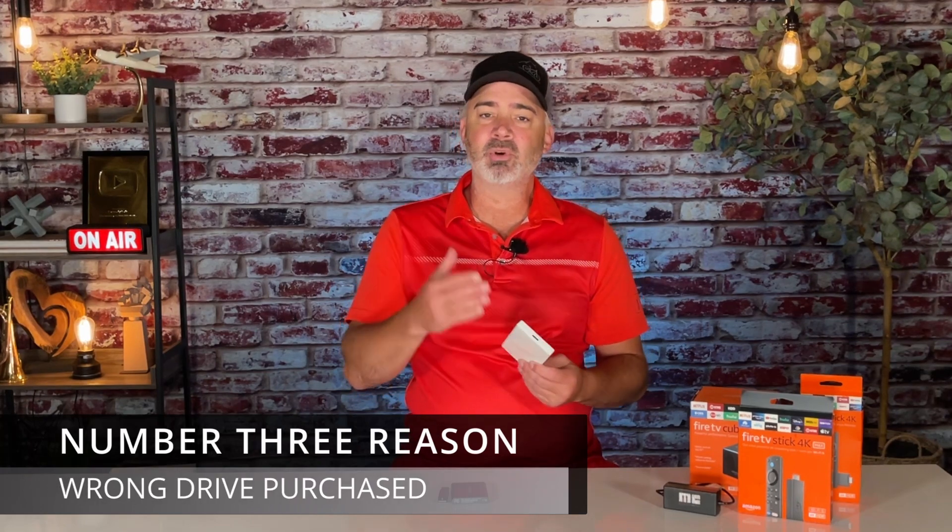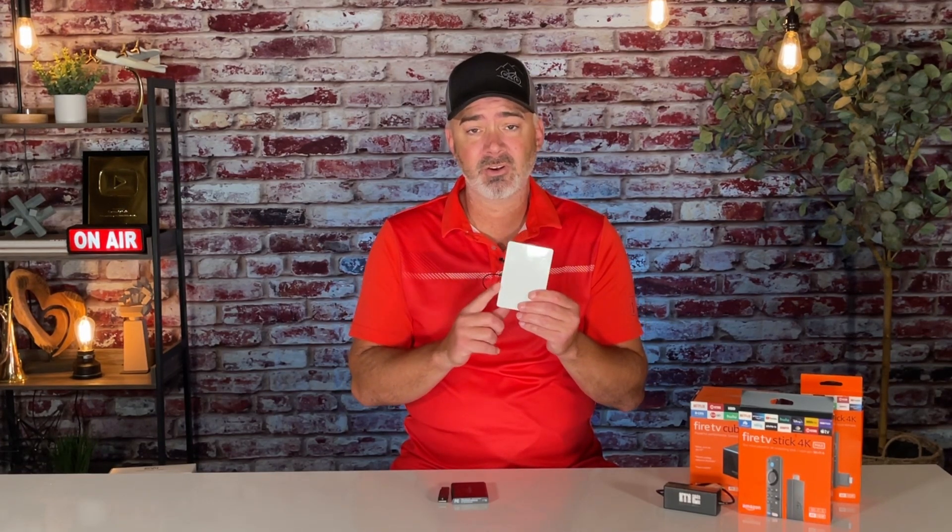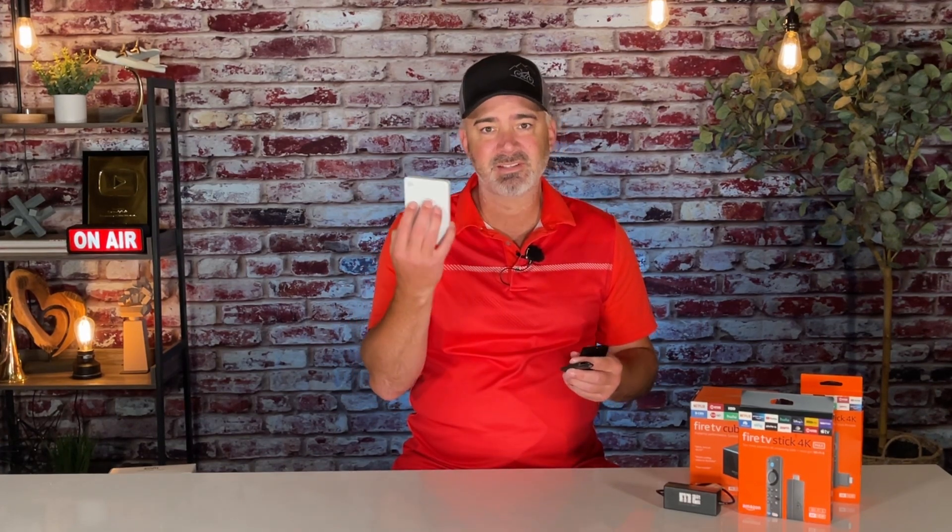The third reason is the drive you chose. I put links in the description of that video, but some people missed them — on mobile you have to tap the video title to reach the description. I showed where to get the Seagate two terabyte drive. It's super important to use that specific drive. I've tried a lot of drives, including an SSD which I love, but it's not compatible with the Fire TV Stick. Many thumb drives aren't compatible either. Some people saw the recommended drive at around $80 and instead bought a two terabyte thumb drive for $20 — it's not a compatible drive format, so it didn't work.